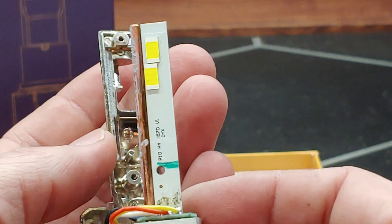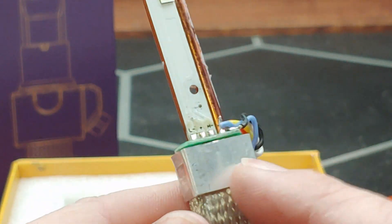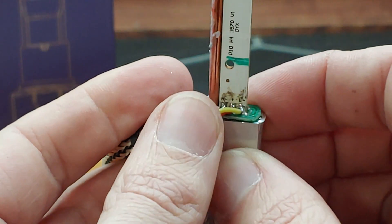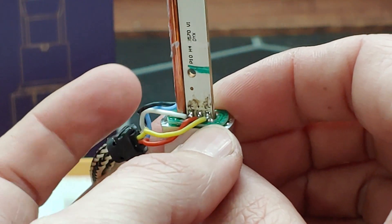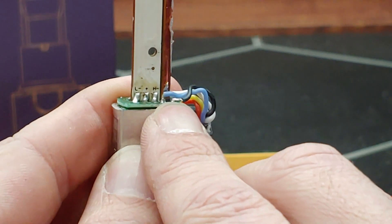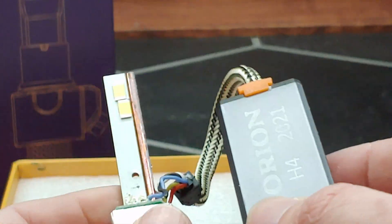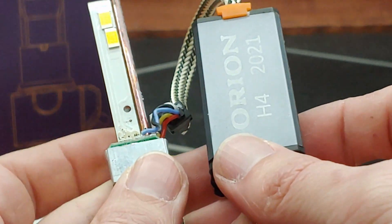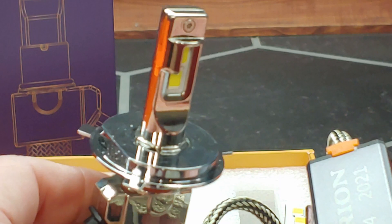We then have additional thermal paste that goes between the housing and the copper heat pipe, which causes so much heat dissipation for this fanless bulb. Down at the base here you can see our smaller circuit board with power distribution for our high beam and low beam positive, and the yellow is ground for the lights. On this side, blue and black go to a small thermal resistor or thermocouple that feeds back to the brain box, limiting current if it gets too warm to keep these from overheating and burning out — a very clever design.